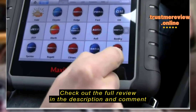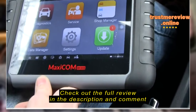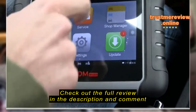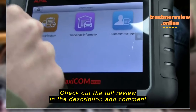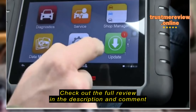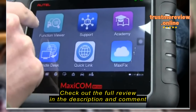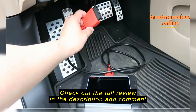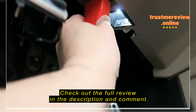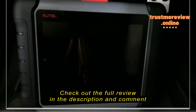This is pretty cool — your live data here. This won't really show us a whole lot since the engine isn't currently running, but this will take all the sensors on the vehicle and anything that can output a useful number, it'll show you. For example, we've got our coolant temperature at zero degrees Celsius — right around 32 degrees, which is about right. Zero engine RPM, of course. Zero vehicle speed. Throttle position — if I peg it, your throttle position goes up. This is all live data for all the different sensors on the engine. O2 sensor voltage, there's a ton of different things you can read through here.